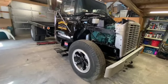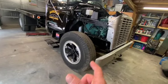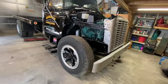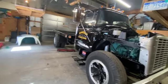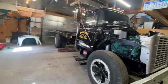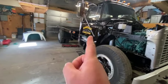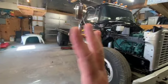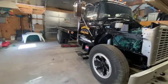So that bus just really didn't make much sense. Plus those newer Internationals have 4-inch wide front springs, which doesn't work with my threes. The rear axles bolt right up, everything's pretty ubiquitous back there. But buses have a much smaller drive shaft and yokes than what I have, so that would have been reworking the drive shaft I just got. That's just too much work for something we've already got figured out. So, I'm happy with it.